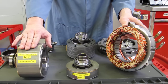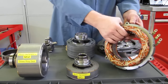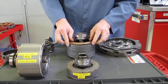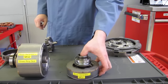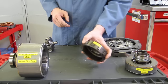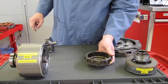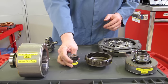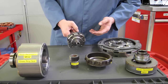MG2, connected ultimately to the front tires, has a giant stator like this, except of course much larger. The Toyota hybrid system uses these two electric motors connected to a standard planetary gear set. A standard planetary gear set has a ring gear — sometimes called an internal gear or annulus gear, Toyota calls it a ring gear — plus a sun gear in the center, and a planet carrier with four planet pinion gears.